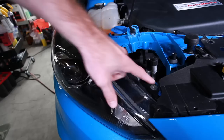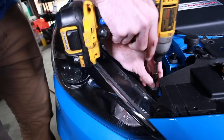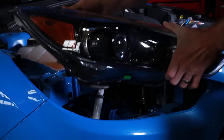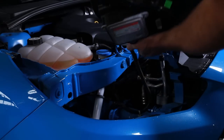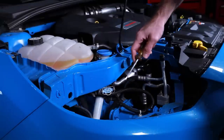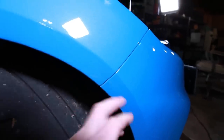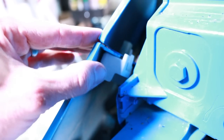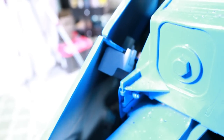Next we need to take the headlights off, so we're going to take these T27s off in the front and on the top. Then unplug the connector right here, take that off, and place the light to the side. Repeat this process on the other side. Now you've got to remove some of the extra tabs down in the bumper area so you can access up inside to remove the bumper. On the inside there is a little bracket — there are two 10mm bolts right down underneath here. Just loosen those up enough to release the white piece of plastic so we can pull out the bumper without any issues.